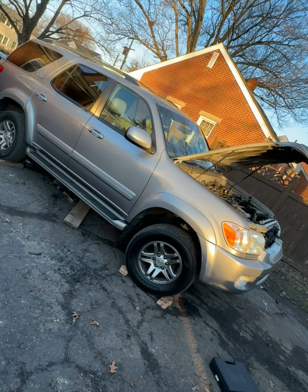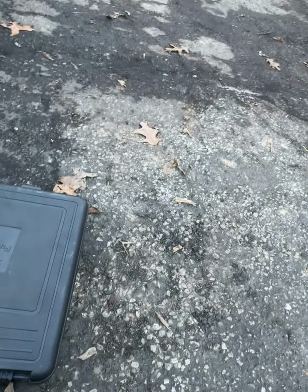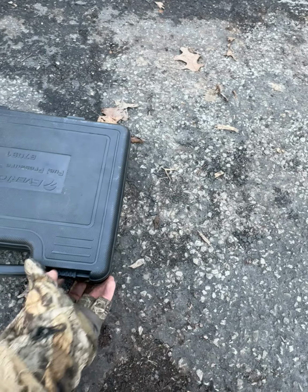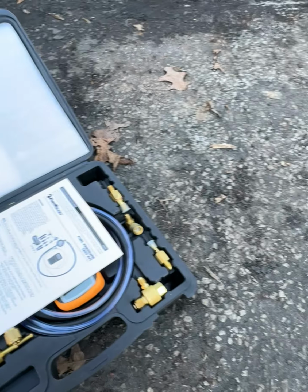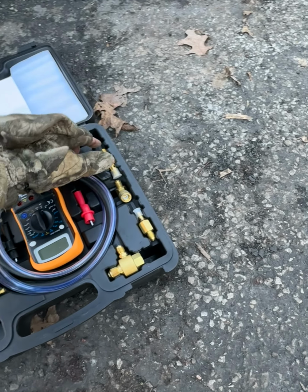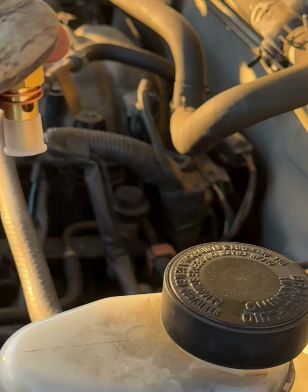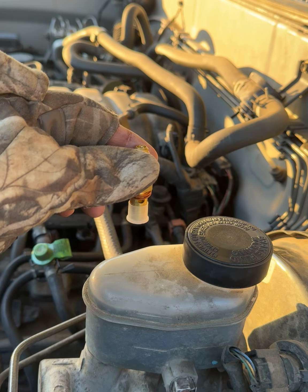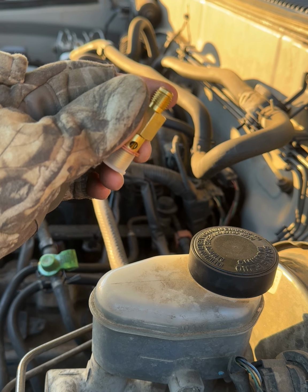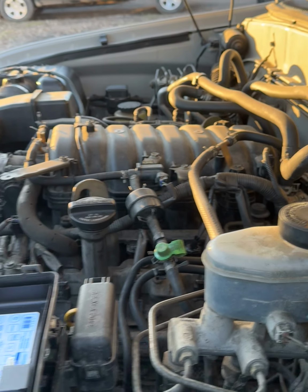She's a babe. Fuel pump will be here tomorrow. Here's the test kit. You get that. $150 to rent. You take it back. They give you your money back. So it was just right on that piece I showed you. I believe this is the same size. So where the hole goes down into where the dampener goes. Okay, so you just take that dampener out and you screw this into where it's at, and then you put the pressure tester on top, the gauge, crank it, and it'll show you pressure.